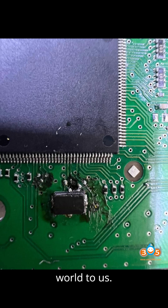In this detailed guide, we'll walk through the process of fixing a damaged BCM body control module in a 2014 Porsche Cayenne, particularly when facing the challenge of all keys being lost. The scenario involves encountering difficulties in reading the BCM due to prior attempted tampering, specifically cutting the board. We'll explore various methods and tools attempted for reading and repairing, highlighting steps to rectify the issue and successfully restore functionality to the BCM.